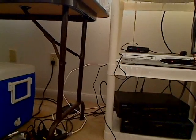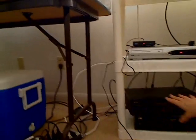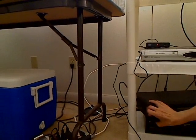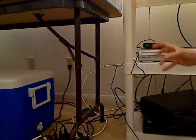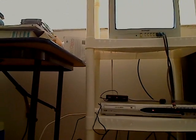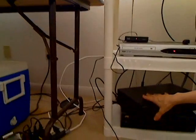I had to rewire everything. Wiring is really important. First of all, I have the audio-visual cables, and they have yellow, white, and red ends. I've got one going out from the VCR up to the television set — you can see it right there. So you want an audio-visual cable going out from your old-fashioned VCR going straight up. In my television, the input part is right up here. So it's going right in there. Audio-visual cables going out from the VCR box into your television set.